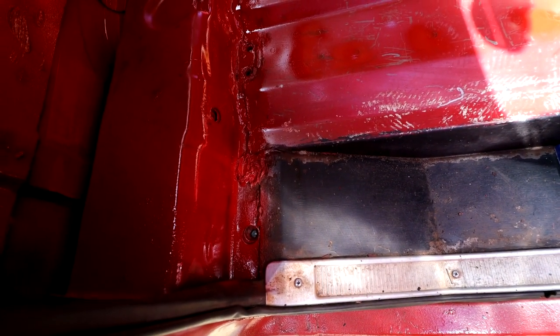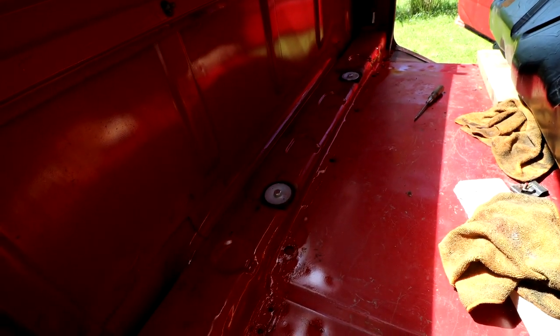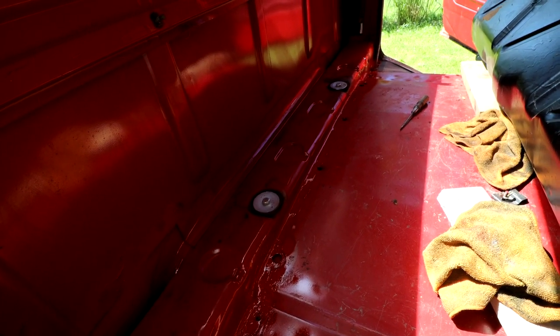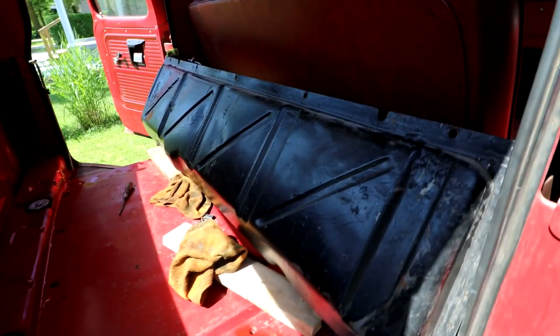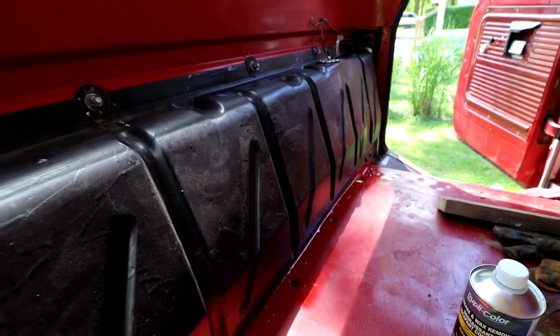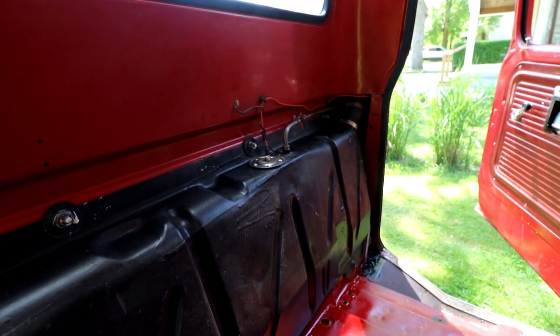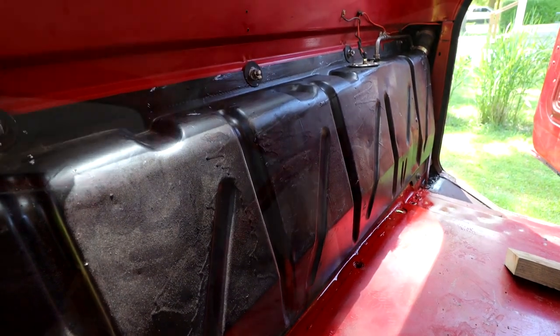I was thinking I can get that fixed — put a new plate, maybe an L-shape so it ties into the back here, which should make it fairly strong. But I think it also needs something running from the front of the cab to the back, because obviously this corner is flexing. When you put your weight on the step to get in, you can see that crack open up a bit. So it's going to take a little engineering. I'm going to strengthen the cab underneath — it may even require taking the cab off, so it could be a big job. I don't want to not be able to use the truck for the whole summer.